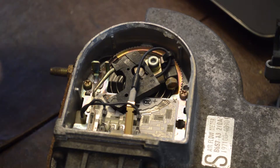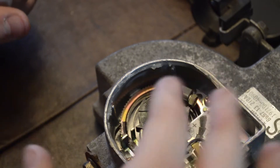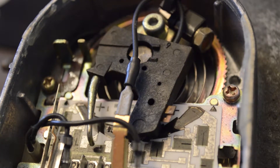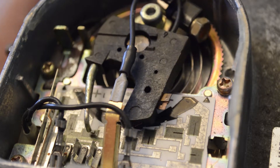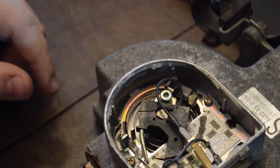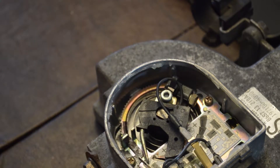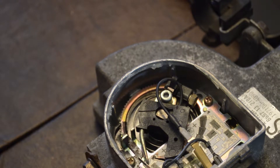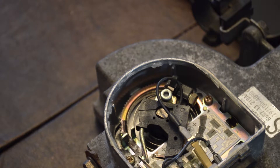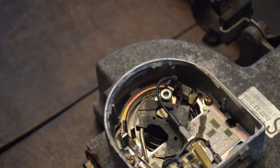The last big thing here — you'll probably see it — is this little black mark on this golden-colored piece. This is the notch for the clock spring. Basically, you can adjust this where it rests on the little clip here, to be tighter or looser, and that adjusts the band of how much voltage is sent to the computer. If you make it tighter, it'll read less airflow, so it'll make it leaner even though there may be more air going through it. If you make it looser, it'll read richer, so it'll make the computer run richer. Our goal is to make it as rich as possible without killing it, so that way we can shoot mad flames. This black mark is the setting I previously found, kind of in the middle where the stock one was — I was stupid and didn't mark it before I adjusted it, so I had to do that afterwards. I'll be messing with this during the actual testing.